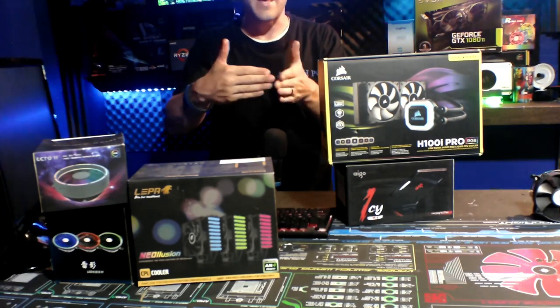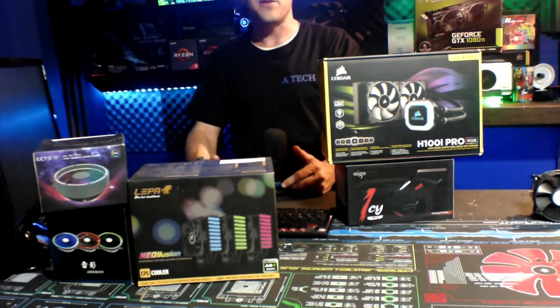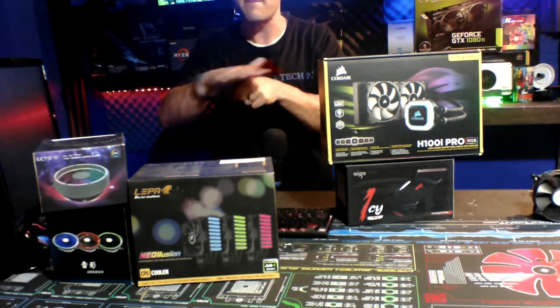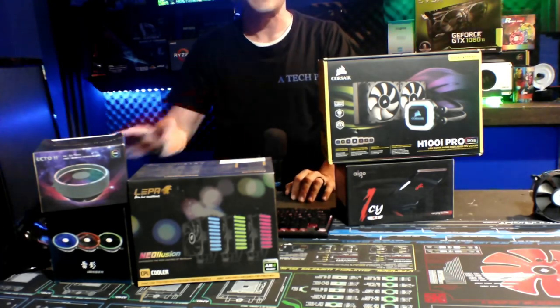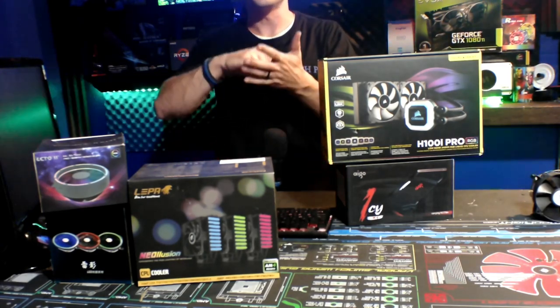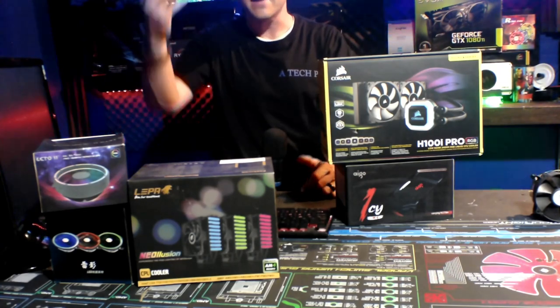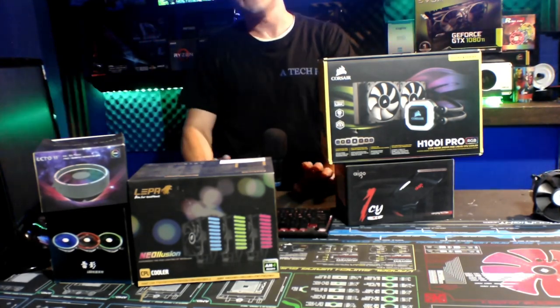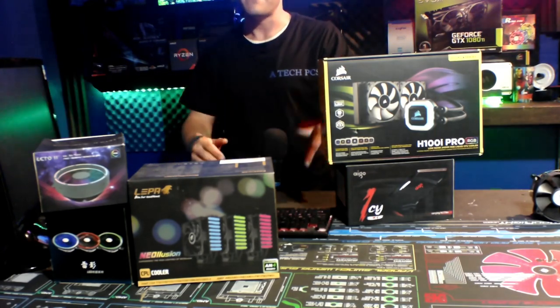And you'll have to check the clearance height on that. And there is no grinding the pipe down or doing anything like that. You cannot modify these in any way. If you modify them, you can destroy the pipes. You can destroy the filament that's inside of the pipes that dissipates and runs the heat. Modifications aren't the best way to go, and I don't recommend that.